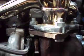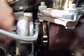In the middle you've got a catch which you'll need to take off. Get that off and the best way to do it is put it in a vise and you've got to tap off this housing away from this section. You basically want to split it, and you need to do that on both sides — one for the exhaust side and also for the intake.